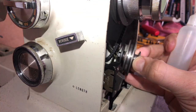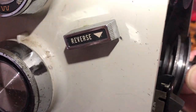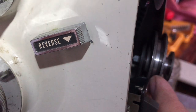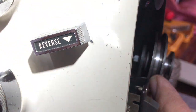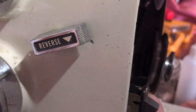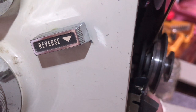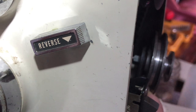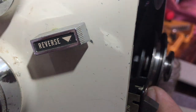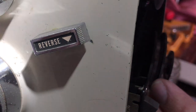What you're looking at here is the back side of that pulley. If you look closely right here, you are going to see a spot where I'm going to put a drop of oil. Do not put a ton of oil here — you do not need it. This is not a normal place that people oil machines; you can check the manual, but this is a servicing location. I'll put two drops there. Notice I did not get any oil on the pulley grooves. A better lesson: do this oiling first and then clean your pulley, so if you drip oil on it you don't have to retrace your steps.